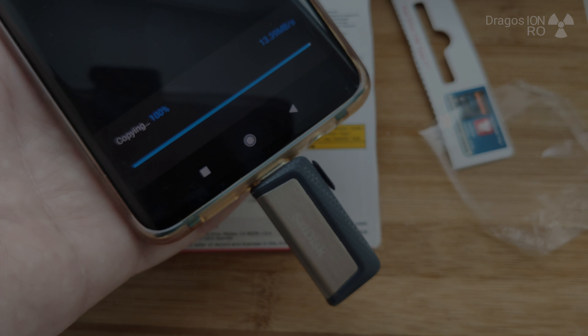Sometimes with fake USB flash drives, they show a capacity that's not really that capacity — you write the files and then you can't read them. So I want to make sure this drive is really working as it should, even though I got it from a trusted place. I always run this test. I did the whole test for the whole drive — everything is great, the speed is as expected, no errors when verifying the files, which is the best thing. Then I have to delete the files manually, but it's not too bad.